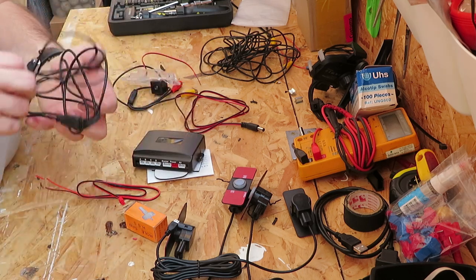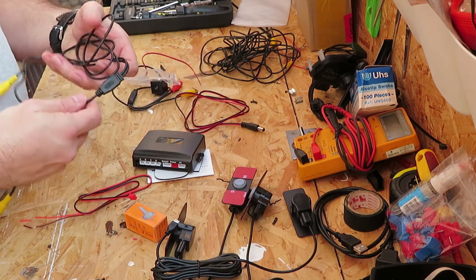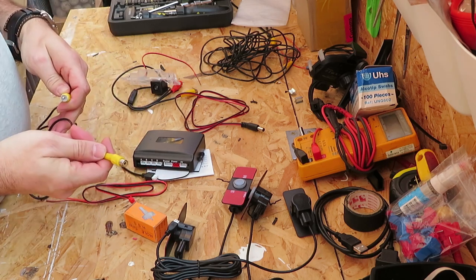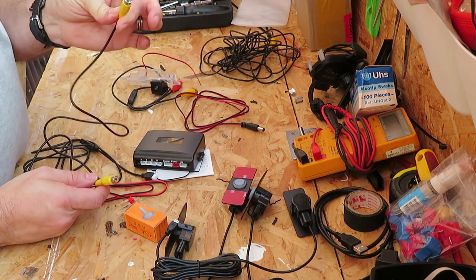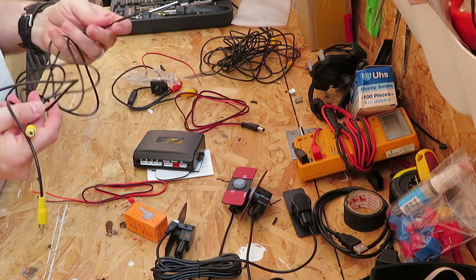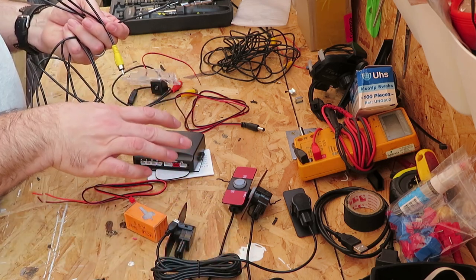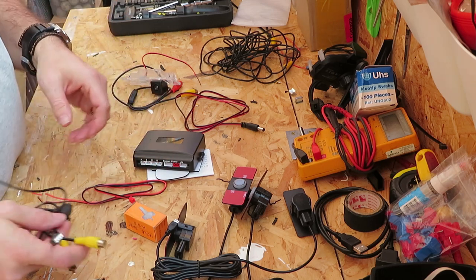Now, this is a bit different to normal sensors because it's got the camera. You've got two leads. Plug your camera into there, and then the camera lead that would normally go to the front is that one. So basically that means that your distance recognition from the parking sensors is then portrayed onto the video image from the reversing camera. Obviously we'll demonstrate that a bit later on.